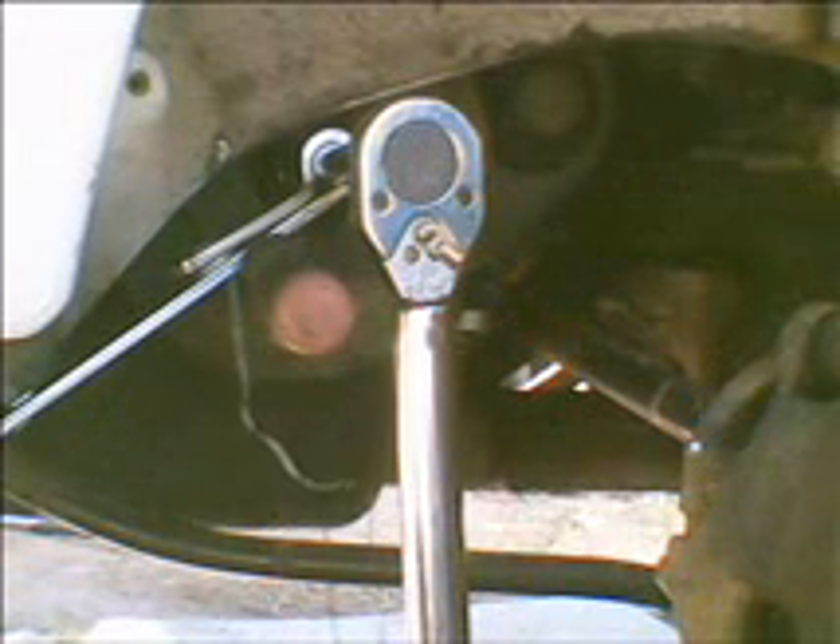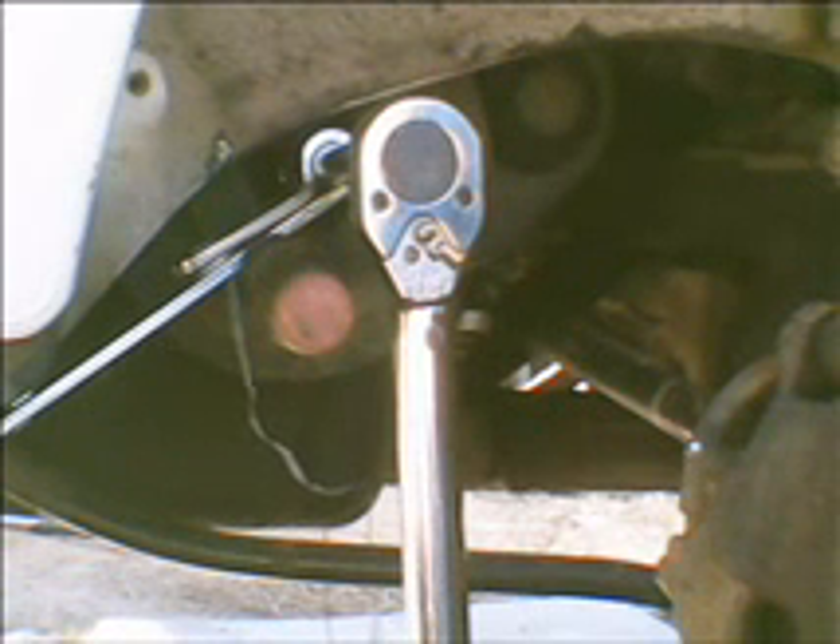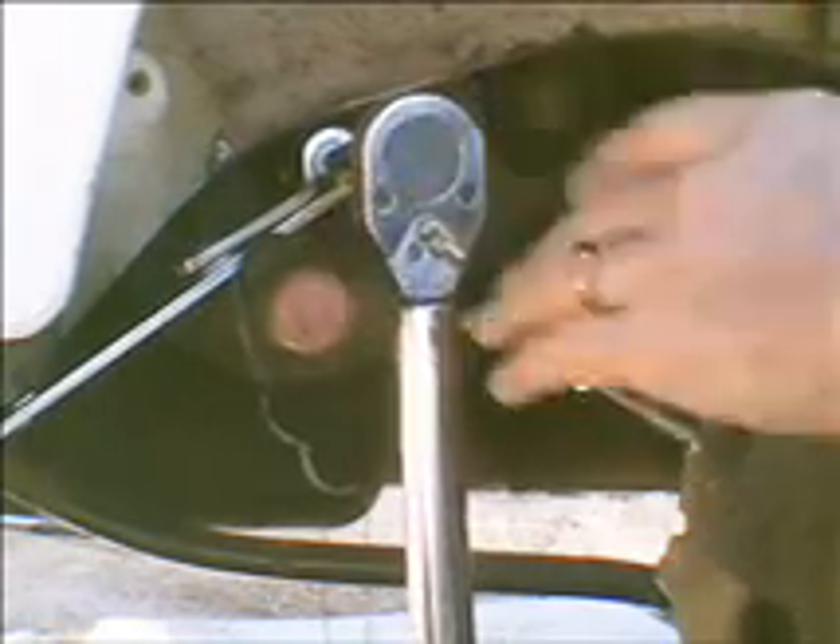I'm going to lie down on the ground and grab back here — you can see my foot. I like to use my right foot and just push with it. I've already tightened this nut so I won't do it again, but I just pushed a couple of times, had to reset the ratchet, and brought it back until I heard it click. I had it set for 140 foot-pounds, which is tight enough — you can go more if you want, up to 150.